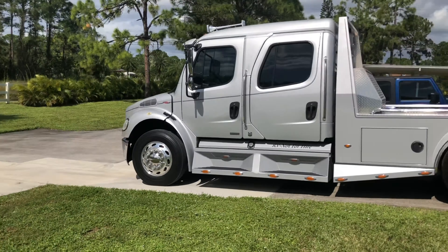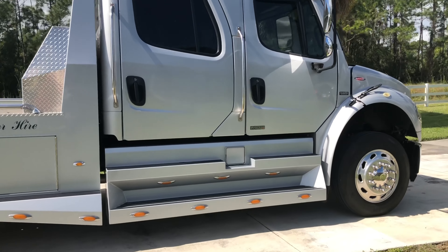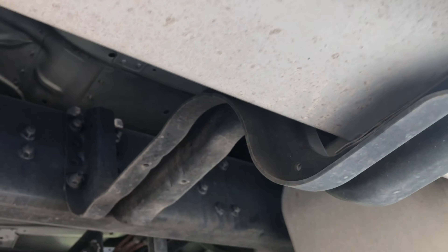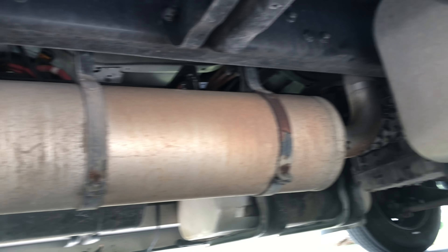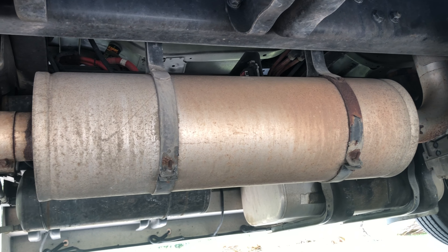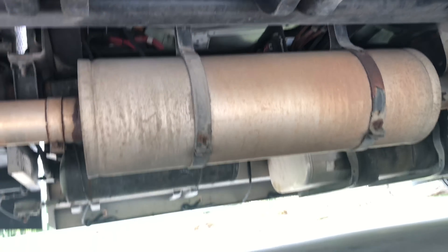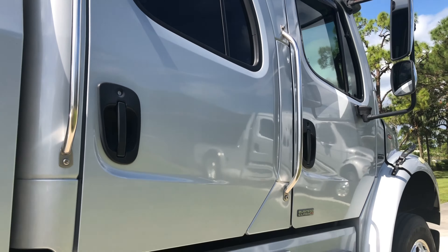It's a matter of preference. Also, both these trucks are true pre-emissions. This right here is your exhaust. If this were a DPF truck — diesel particulate filter — you'd have a big afterburner-looking thing with sensors and ports sticking out of it. That's how you know you've got a DPF truck. Of course it has no DEF either, and I think DEF and DPF didn't come out until 2008 or 2009.